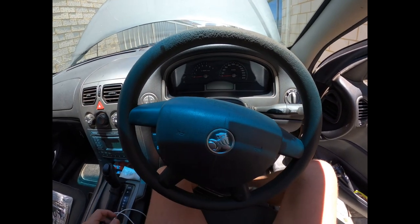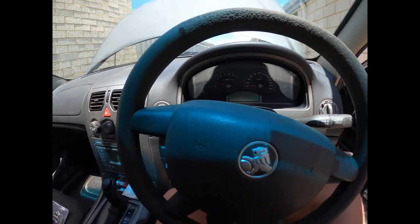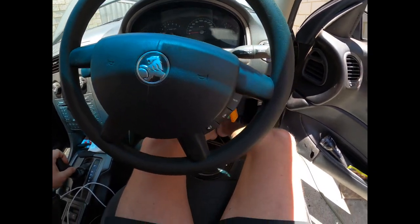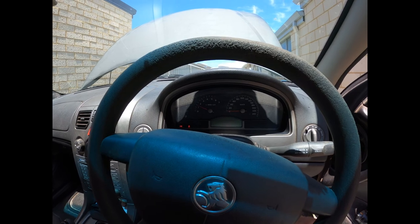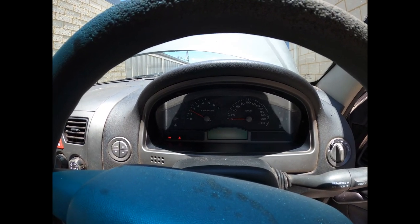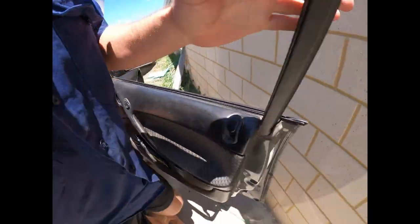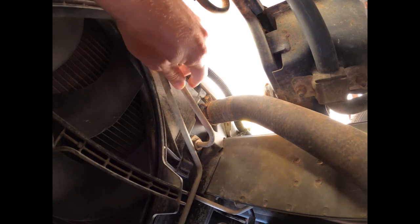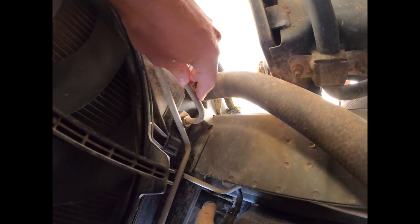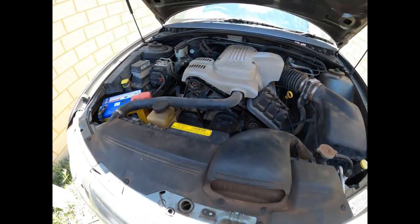Now I'm not sure which of those two pipes is which, so I'm just going to start the engine and chuck her in drive, put on the brake and accelerate for a bit just to engage the transmission and get some fluid pumping around. Just a matter of checking which pipe is warm — this bottom one is definitely the warmer of the two, so it's obviously come out of the transmission. So we'll have to detach that one, add a tube to it, turn the engine on and pump out all the old fluid. Let's get started.